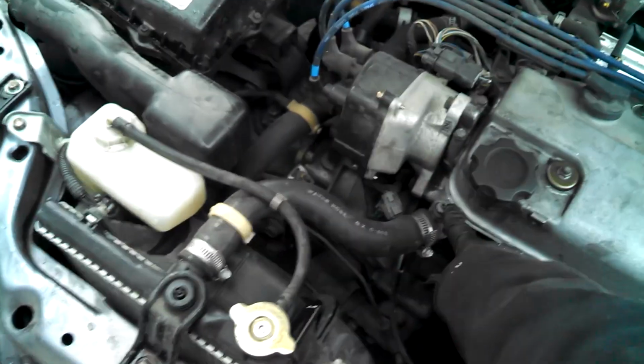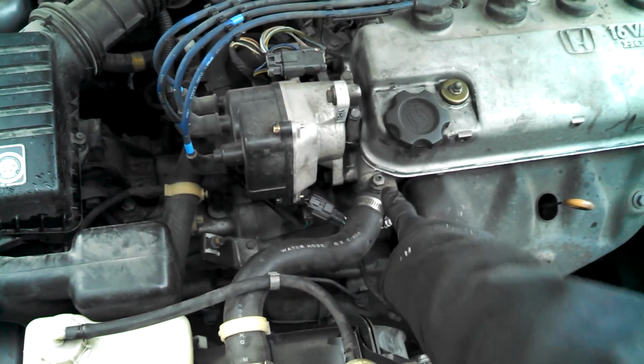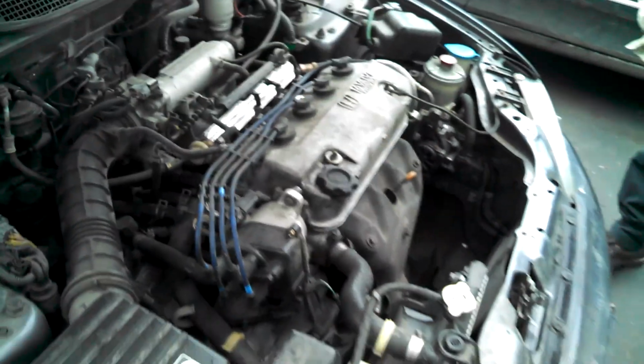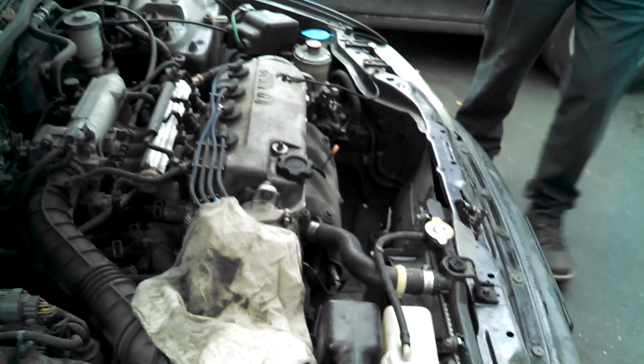When you're adding coolant, open up this 12 millimeter vent. So when you add coolant in here, keep adding your 50-50 mix of coolant until fluid comes out of there and it's full, and you put the cap on, tighten that up, run it for 5 minutes. Should be getting some heat after 5 minutes. If not, shut it down and double check your coolant level.